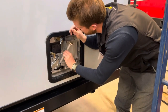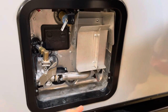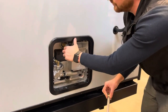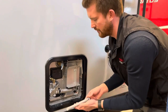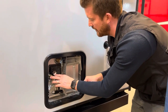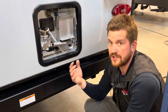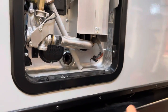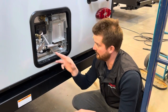Inside the tank there are a couple of reset buttons. If you ever overheat the tank and it fails to start up on propane or electricity, come out here and press in on these two reset buttons to reset those energy cutoffs. You've also got a water pressure relief valve here — if the tank ever over-pressurizes, it'll pop this and bleed some water out. Before you pull the drain plug when winterizing, pull this relief valve to bleed the pressure off the tank so there's no water pressure in there when you pull the plug. Last thing: if you plan to run it on electricity while at a site with power hookups, there's a little black rocker switch at the bottom here that'll need to be turned on. We leave that off to ensure you don't accidentally start up the tank on electricity, but if you want to operate it electrically, you'll have to turn that on.